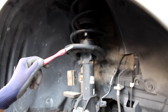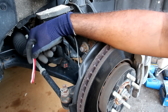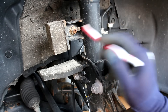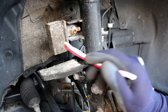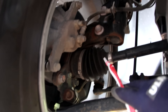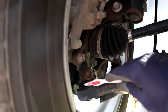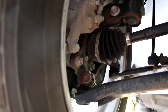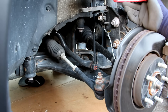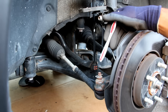The front suspension on the CX-5 is just a McPherson strut style suspension bolted on to a cast steel knuckle, and even the lower control arm is a stamped steel material. Here we've got the inner and outer tie rods as well as the stabilizer link as it joins to the stabilizer bar going over to the other side. Where the stabilizer link joins at the strut, you've got these two weird rubber isolators to prevent any resonance from traveling into the cabin. The bearings are a bolted-on style with a steel steering knuckle. The ball joint is not replaceable in the control arm but it does use a pinch bolt style design — good luck getting that out when it rusts in there. Although the CX-5 does handle well, McPherson strut suspension won't handle as well as double wishbone for example. Overall I'm pretty disappointed by the lack of use of aluminum in the suspension setup to lighten things up and help prevent some of this corrosion.